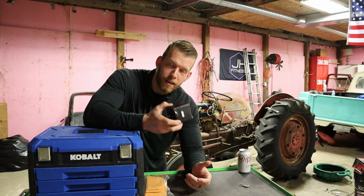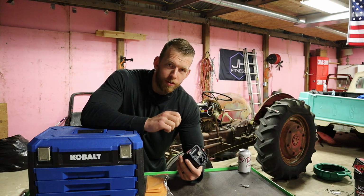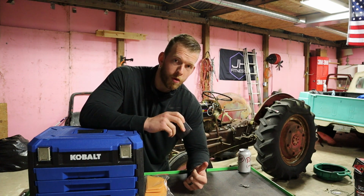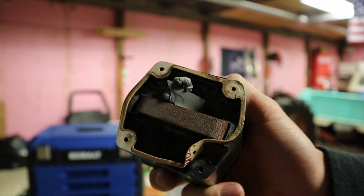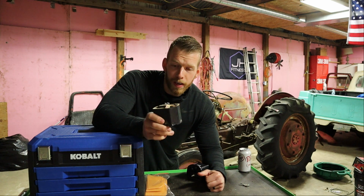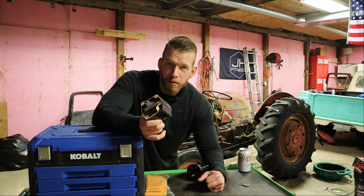The coil came in. If you didn't watch the last video, I left the ignition on and I'm pretty sure that's what fried it. Also, there's some uncertainty whether the old coil was a 6 volt or a 12 volt since this thing's been converted to 12 volt. But it was pretty gnarly looking. And by gnarly looking, I mean like that. But anyways, this one smells really burnt up. I'm sure that this is just absolutely toast. I was getting absolutely no current through it at all.